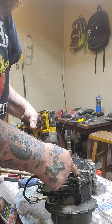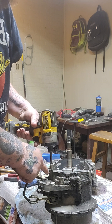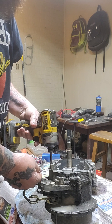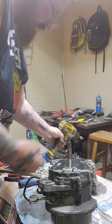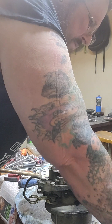You take the plug out of the side, or you can leave the one in the side — it don't matter. There are six bolts holding the transmission together — the guts in the tranny. So we'll take those six bolts out and set them aside.